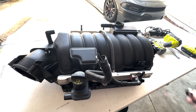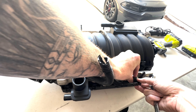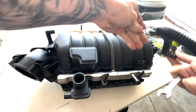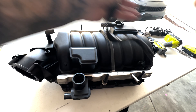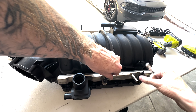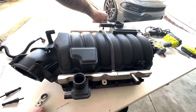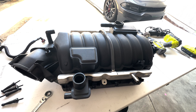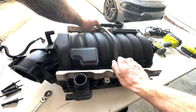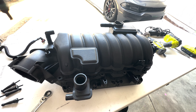For some of the easier steps, we're going to go ahead and take off the oil fill cap and set that aside. Take off this fuel hose — make sure I don't lose that clip. Then for the fuel rail bolts, you can just use a 14mm. You want to loosen them until you can get them off by hand. Once those come off, you can give it some force to pop off the fuel rail. It does have a lot of gunk on it and a little bit of gas, so make sure you move that out of the way.